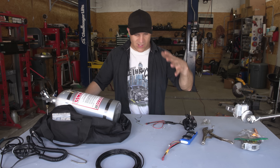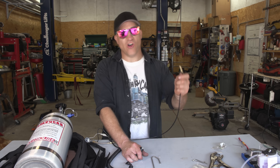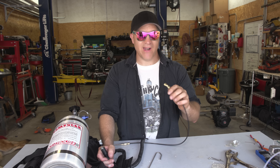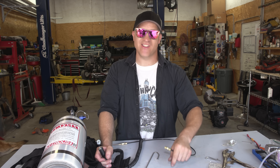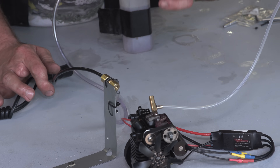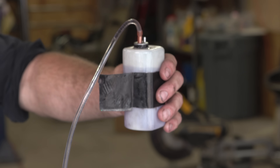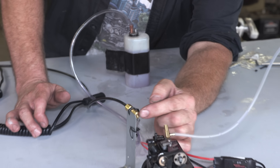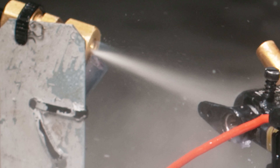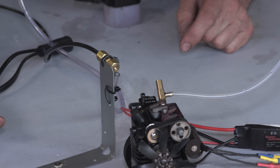Now that you've seen the nitrous kit I'm going to use, let me get this all set up. What can go wrong, right? I got the nitrous system all set up. I picked jet size number 16 — I don't know what horsepower rating that is, but I can tell you it's way too much nitrous for this little tiny engine. I have the nitrous delivery tube with the nozzle aimed right into the carburetor. The other thing we're going to need with all that nitrous is additional fuel, so I hooked up an auxiliary fuel tank with a tube placed just in front of the nitrous nozzle, using a siphoning effect.